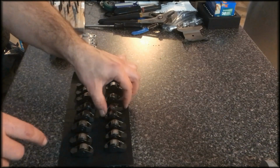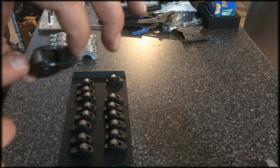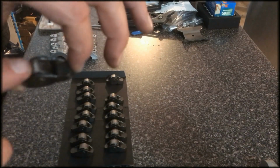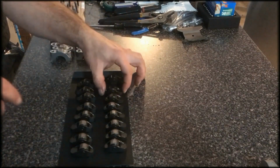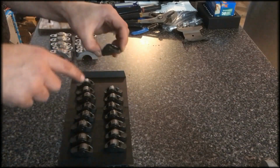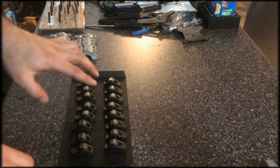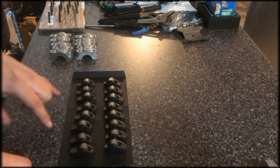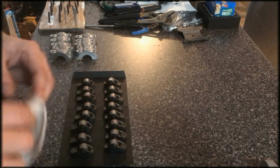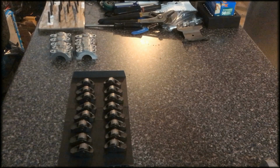If I'm looking at the other ones, yeah, this is significant. You can see that. It's an actual groove inside. Continue on. I mean, there's one there. You can see the marks on there, but again, we're looking at the third cylinder. So the score marks on the third cylinder on the rockers are deeper. So that tells me, again, there was stress in that third cylinder.